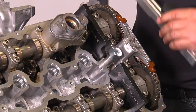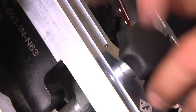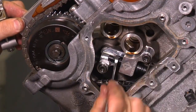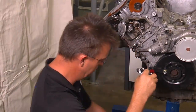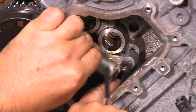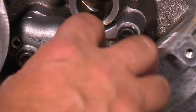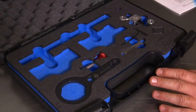If they do fit perfectly — very important — reinstall the cam hold-down bracket prior to installing the original tensioner. This will prevent the cams from rotating during removal due to the load from the valves. Release the tension on the timing chain tensioning tool, remove it, and transfer the bolts to the factory tensioner. Install the factory chain tensioner and torque to 13 newton meters or 9.6 foot-pounds. Now remove the chain tensioner pin, remove all other tools, and the cam timing is complete.